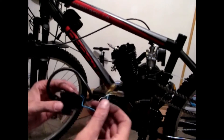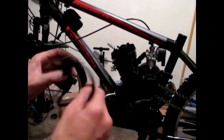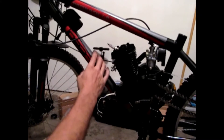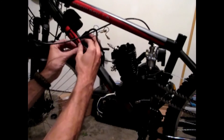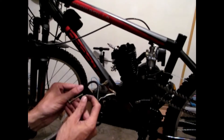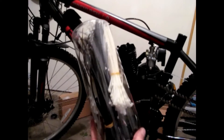We're going to mount the coil or electrical distributor. These are the wires that come from the engine — this is the one that connects to the spark plug. You want to mount it up top. This bike has a pretty big front frame part, so when you try to mount it like this it won't mount. You're supposed to have these go through with little screws, but it's physically not possible, so I grab out the cable ties.